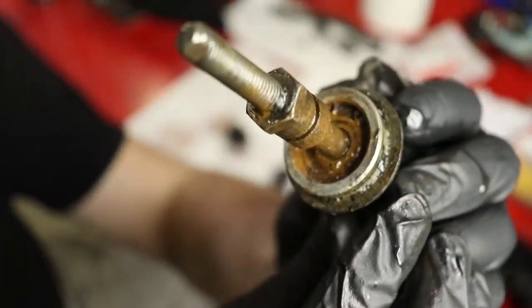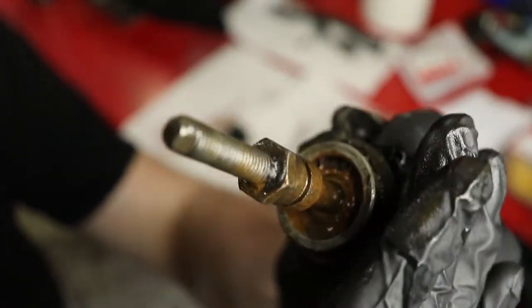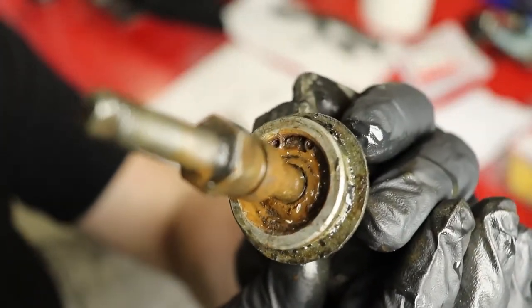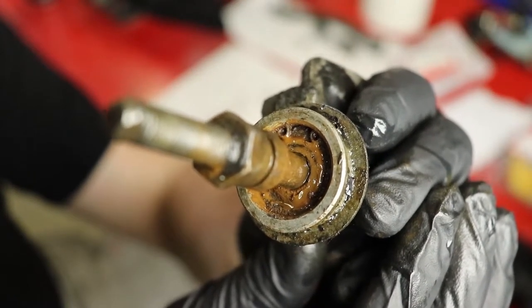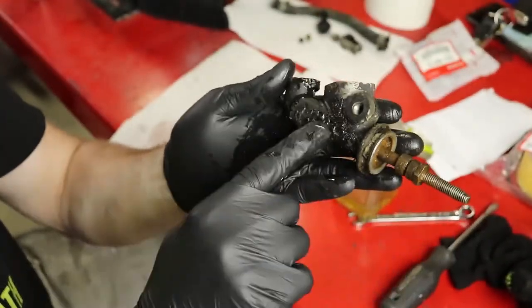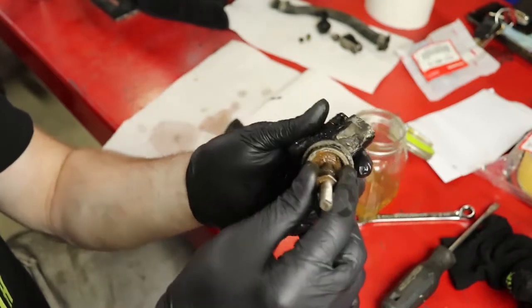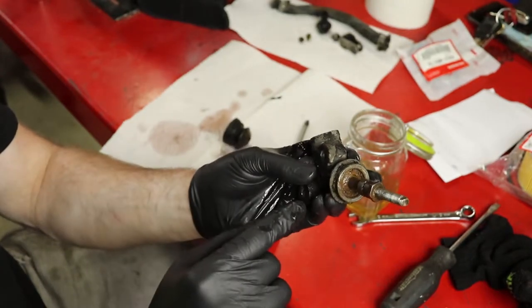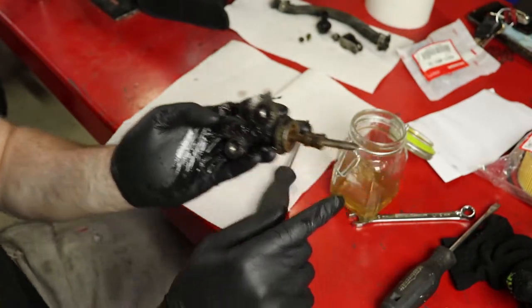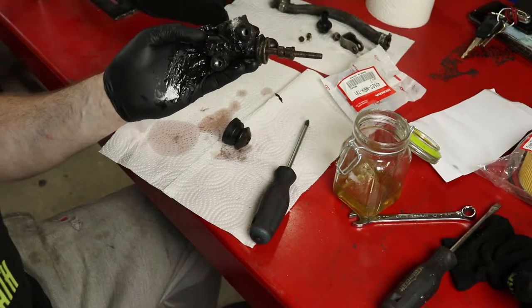I'm going to try to get your eyes on this — you can see that circlip right in here, that's relatively rusted in. So I'm going to go dig on that for a bit; once I get that out I can take the rest of this apart. I'm definitely going to wire wheel all this old black paint off of this. I'll get the plunger and internals out, wire wheel it clean, hit it all with some brake cleaner, then start putting the new rebuild kit back into it. I'll bring you guys back shortly.